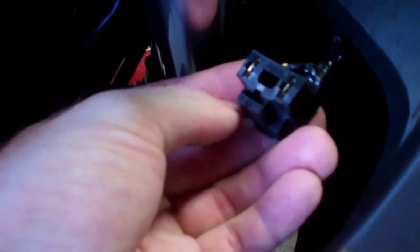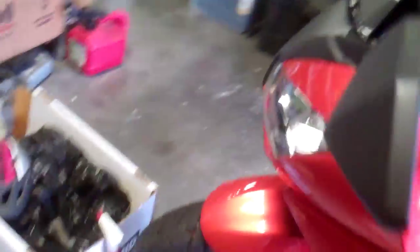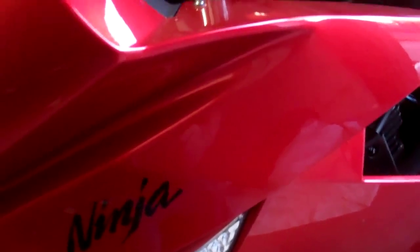To unplug the headlights it's simple - you just reach right in there and pull the cover off the back of the bulb. Wiggle a little bit, give it a little tug - there it goes, and I just pulled this off of it. Simple. As for the turn signal wires, there are little plastic pieces that lock them in place. But if you look underneath here, you can reach in there and squeeze it to release the tab, which will allow the whole locking mechanism to be separated, so you can remove the fairing.